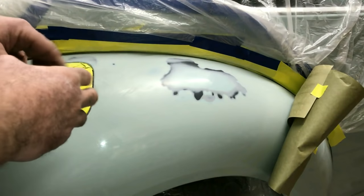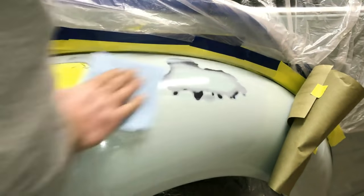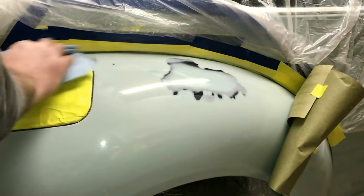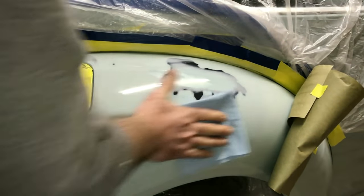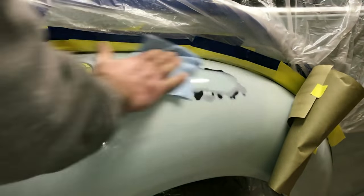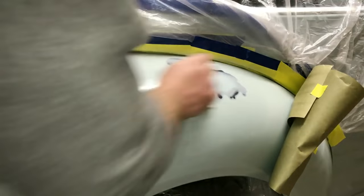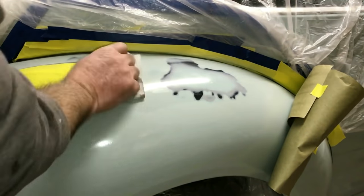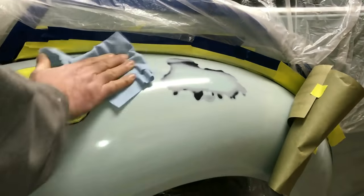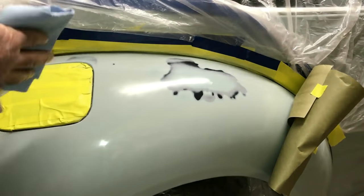Keep your eyes peeled. First, we're going to clean it with a rubbing alcohol. This will get all the grease and oil off. Then, just to make sure, I like to go over it with a prep rag, and I think you should as well, and a tack cloth. Now when you go over it with your prep cloth, you just wipe it on, and that even assures more that you won't have any grease. And then wipe it all off with a nice clean blue shop towel.